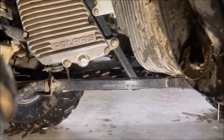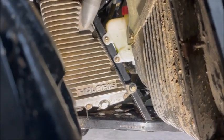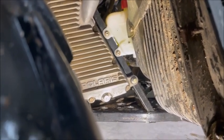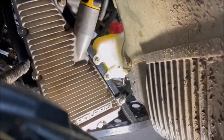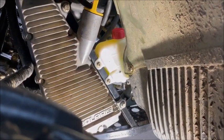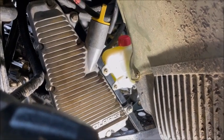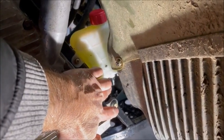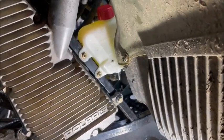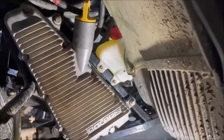The fill cap is back on, nice and clean. I had already replaced the washer — the seven-dollar Teflon washer — because I was desperate to stop the original leak, but that didn't work. I did reuse that brand new washer here. Also, if you noticed in the earlier clips, my radiator reservoir was leaking from that nipple. I took the opportunity while the tank was out to fix that too — it turned out there was no Teflon tape on the thread of that black nipple. I unscrewed it, put some Teflon tape, and put it back on and it's holding up.